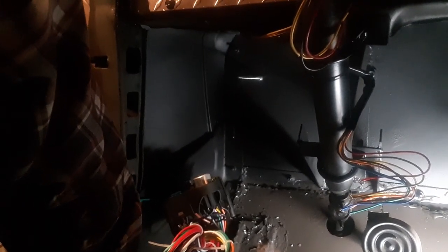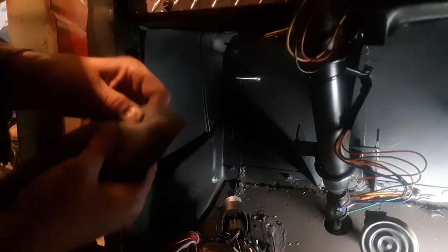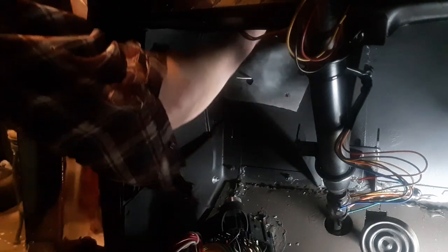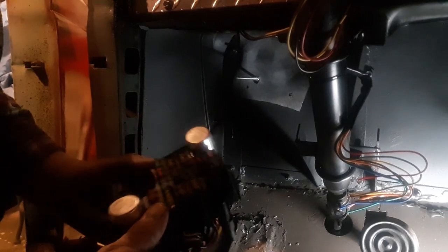What I'm going to do is use a piece of rubber — inner tube. I'm going to put a couple of holes in it, one there and one there, and push that up to the firewall. What that does is when these wires bend around this, if they do touch that firewall, they ain't going to vibrate through and cause a hellacious fire.